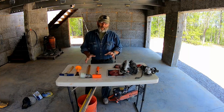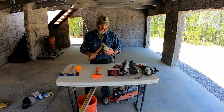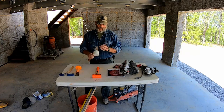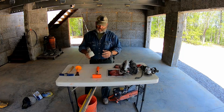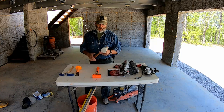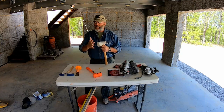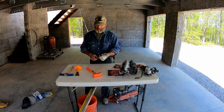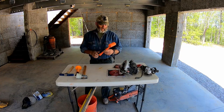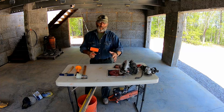The other striking tool you're going to want is some sort of soft-face hammer. What you saw me using is a flooring mallet — it's got a rubber face and a steel head so it has some weight to it. Most instances it was fine, but I probably should have used a dead blow hammer because the rubber face sometimes gave a little rebound and made it hard to get things lined up exactly. The dead blow from Harbor Freight has weight to it but a soft face so you won't chip the block.